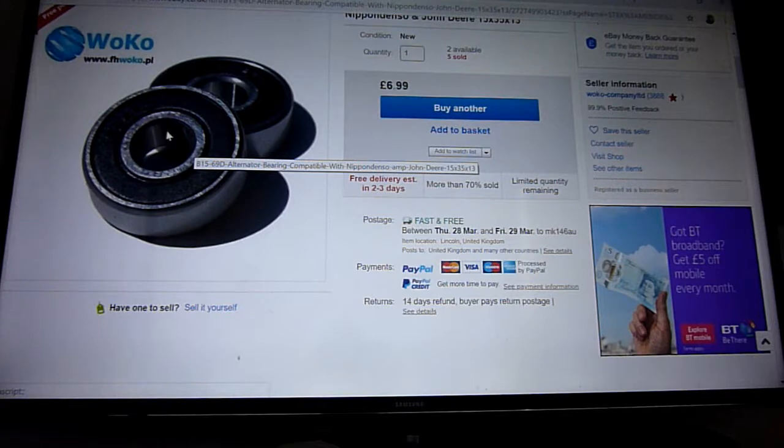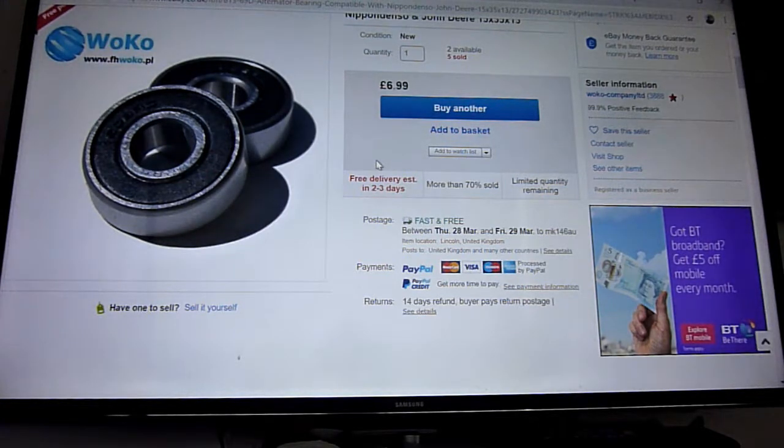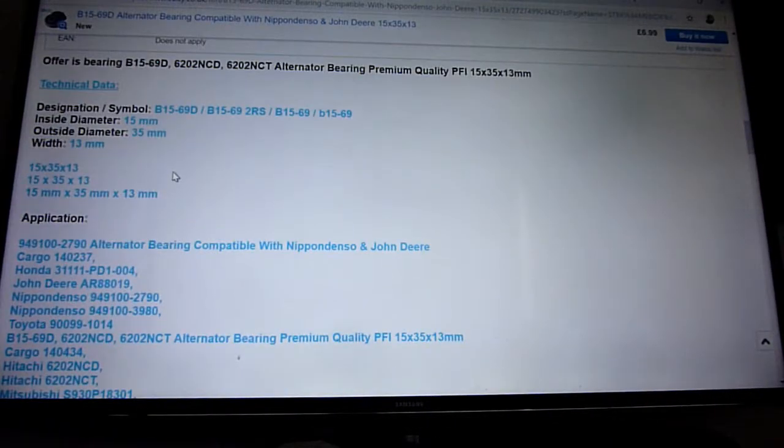Maybe it's the camera angle, I'm not sure. It just looks a bit rough. £6.99, so a fair bit cheaper, but cheapness is not what I really want. It's quality. So the bearing that goes on the stator is 15 times 35 times 13. We already knew that. 15 is inner diameter, 35 is the outer diameter, and 13 is the depth of it. And it fits, in this case, the Honda